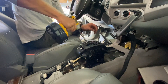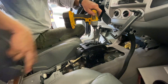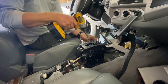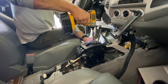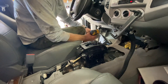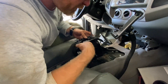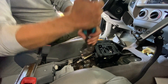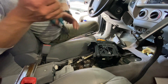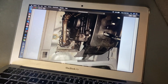I took off the shifter - the top of the shifter just unscrews. Took out the two bolts on this side - those are both 12mm. Took out these two 10mm bolts; you probably can't see them but they're inside your center console underneath the carpet. All this stuff popped out pretty nice and easy without a lot of trouble or a screwdriver. Channel locks did it - the little C-clip for the shifter is out, shifter is out.